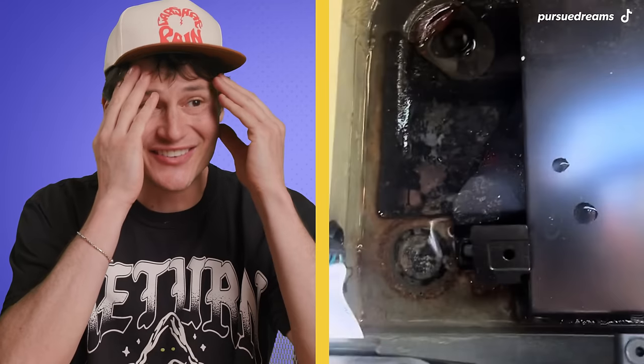What's really shitty is because it has to go towards the back of the vehicle, and then the tubes go out. If it's clogged, that water's gonna flood the back. And luckily, Germans already thought about that. That's why they put all of your modules back there. There's always a computer in there worrying. It floods up with water. Luxury does not mean longevity. When they build those cars, where they're at, it rains a lot. So they know they're gonna mess you over. Why make a little tub? And they make them sealed. Like, you can't even make a hole so it could drain out whatever moisture, water goes in there. It's sealed, solid. Dude, at least pick it up, you know? All full-on conspiracy theory, dude.